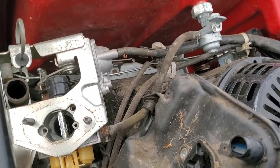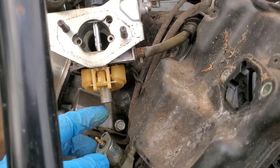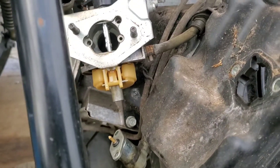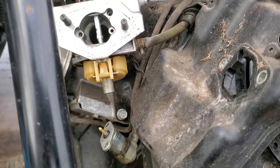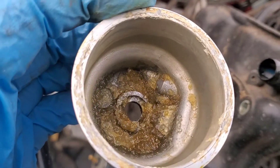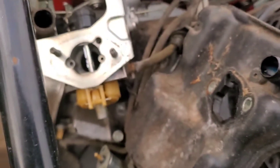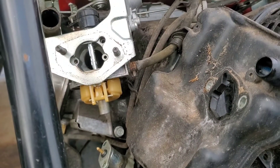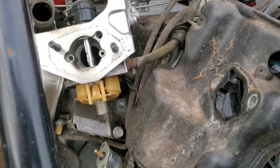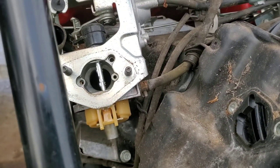On this one it doesn't have a carburetor drain, but you could take off the electronic fuel shutoff and the fuel will come out of the bottom of the carburetor bowl, or just dismantle it and put it back together dry. It doesn't hurt to check in there once in a while — sometimes stuff like this can happen even in a short period of time, and it may not plug your jets right away. The machine may run 60 hours like that with no problem, then one day when you really need it, that stuff gets stuck in a jet and it won't start.